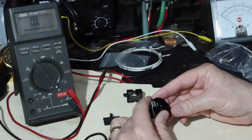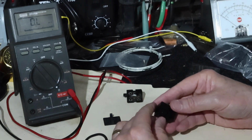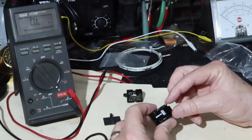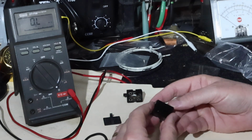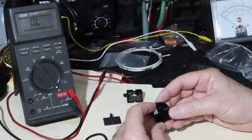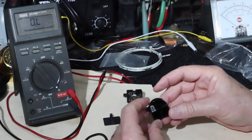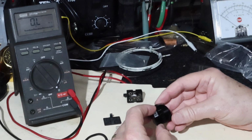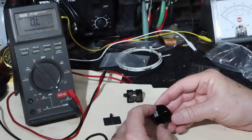All right, let me see if I can rig up a way where I can put 100 volts or 120 volts from here to the starter winding. And rather than trying to measure the resistance across there, which of course you really don't do, what I'll do is I'll measure the voltage drop across here, and then that'll show us the behavior that we're looking for. So we get that rigged up, I'll bring you right back.